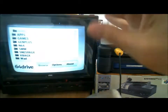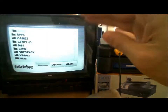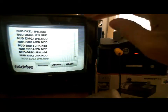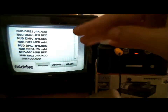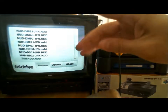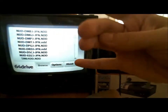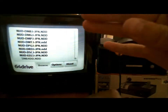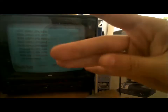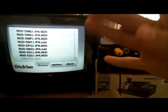Let's show off actually writing something. We're going to use the Super Mario 64 DD version — actually it's not just to show off that it works, it's because it also happens to be a retail disk image. And normally, even with LeoWrite, you weren't exactly allowed to write a retail disk image onto a dev disk. The way around that is to basically reformat the disk and ignore certain parts of the system data.